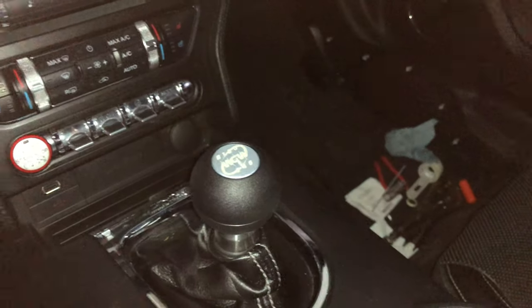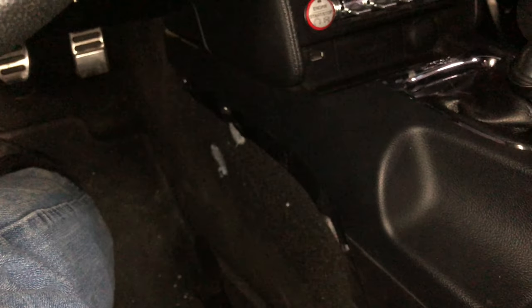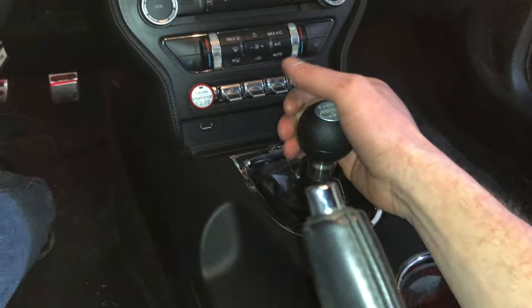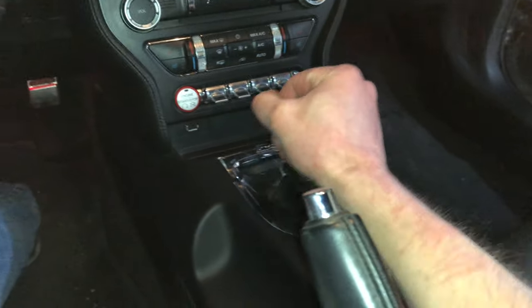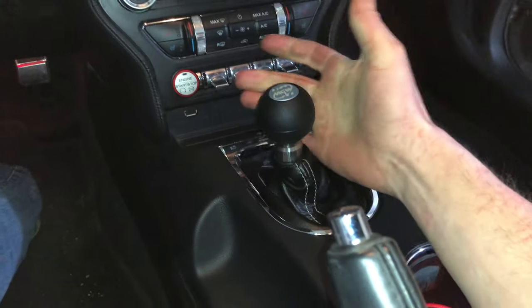It doesn't turn at all once that set screw is tight. For the final steps, MGW gives you sound deadening foam pieces — there are slits in the back so you know which side goes toward the bolt holes. Slip that over the top, then reinstall your factory insulation material over it. When you put the center console cover back in, make sure you get both plugs reconnected at the bottom, or the car won't start and your MyColor won't work. Put your 7mm screws back in on each side panel, snap the panels back on, and you're officially done. This thing has ridiculously short gates — it's going to be really interesting to drive. If you're interested in seeing the test drive video or have any questions on the install, we'll catch you in the next video.